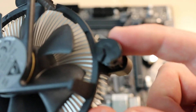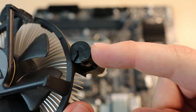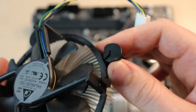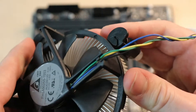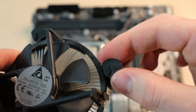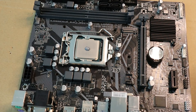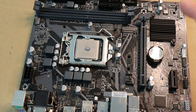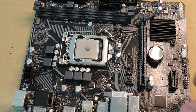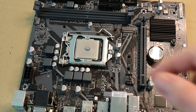To prepare the cooler, take a close look at the latches — you'll see there's an arrow pointing to the left. What you want to do is give them a little pull up and unwind them back to the right, just like this; you should notice they will likely click each time. I've gone ahead and put the board on a piece of cardboard — you won't have to do this normally if your motherboard is inside the computer already. I've done this because it allows me to push down on the clips when I go to install the fan.